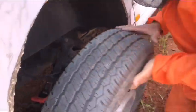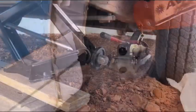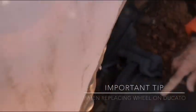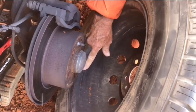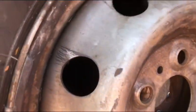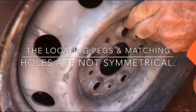What it highlighted were the weaknesses in trying to change a wheel on the side of the road. I'll do up a separate list on things that you need. For starters, you need a backup jacking system. On the Ducato, when replacing the wheel, you need to align the two pillars with the two domed holes — they're not symmetrical, so don't be fooled.